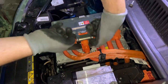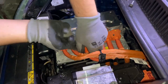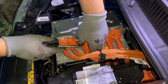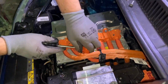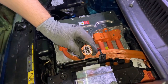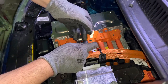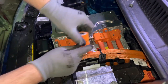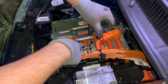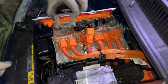Then there are two connectors on the bottom that are also holding this connector and you cannot remove it easily. There is another black button here that you can push and you will release this connector. This connector's part number is 5C-097373-7. When this is done, there is one metal part that is holding the whole plate — you just need to push it and that's it.